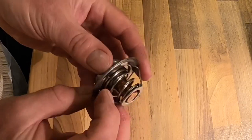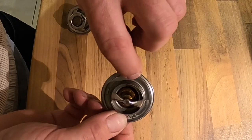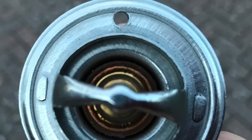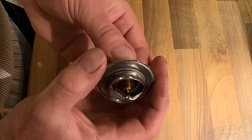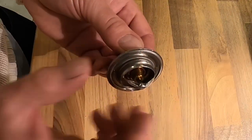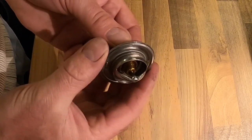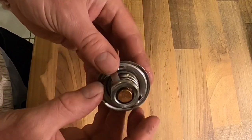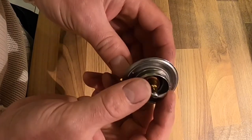And a little trick here will be, when I install this thermostat, I'm going to drill a small three or four mil hole through the casing here, and install that at the top of the thermostat. This will allow the air to bypass it and to bleed through - to allow it to escape as the water fills up in the engine. So that's a little trick; they don't come as standard. It's a little trick to prevent any airlocks.